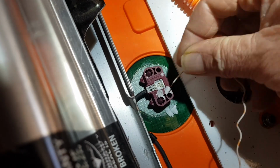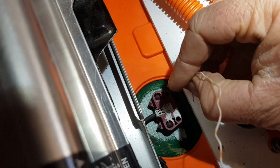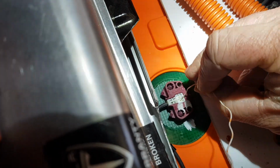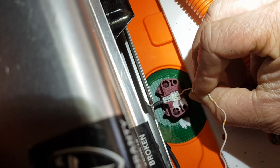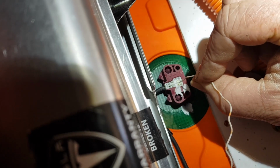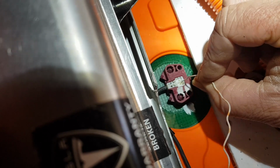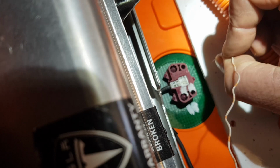So if I test here, the continuity, I'm not touching the pin, I'm just touching the wire side. Oops, this is easy without a phone. So yeah, got continuity through the wire, but I'm not touching the pin to the BMB, battery management board, which you can see just in the middle there. If I touch that, no continuity. If I jam this in, then you can see the gap in there. I reckon that's my problem there, definitely.